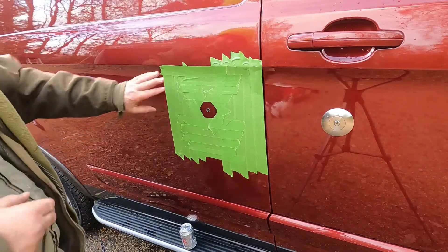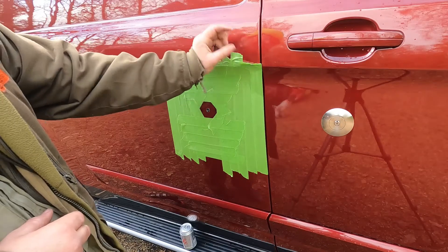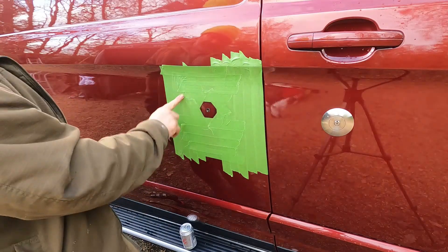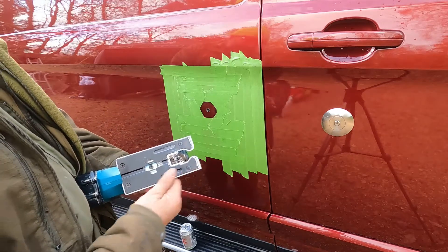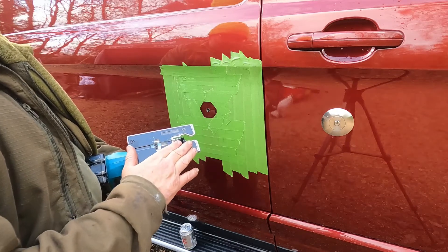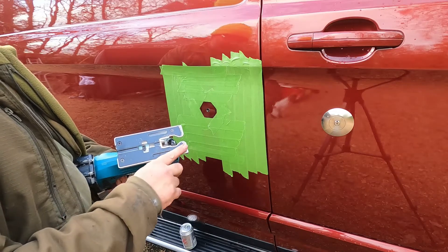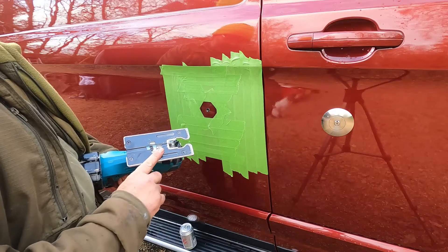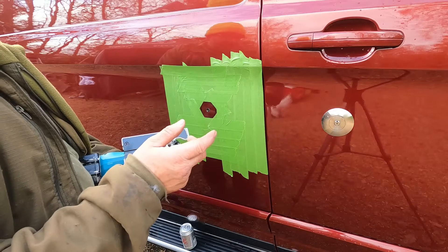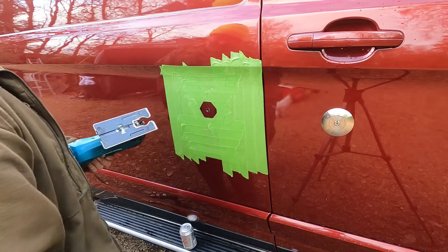This is Decoace masking tape — it has a low tack so it won't leave any residue on the paintwork. The reason I'm taping the panel rather than the bottom of the jigsaw like a lot of people do is that last time some swarf got onto the masking tape and left a slight mark. That was fine because the fan light covered it, but this time it's on the side of the van and I don't want any marks.